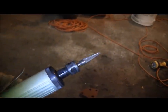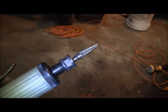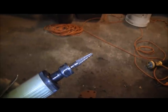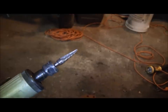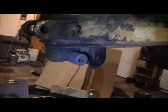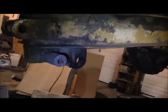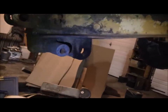Using my die grinder with a triangular burr on it, I got the lock pin out of the casting without much trouble. This is a tool we use quite often when working on repro bodies or any kind of old car stuff — it never fails when you need to slot a hole or get a hole lined up a little better. For the main pin, I ended up having to heat the casting cherry red three times and drive and pound until we could finally get that broken pin out of the casting.